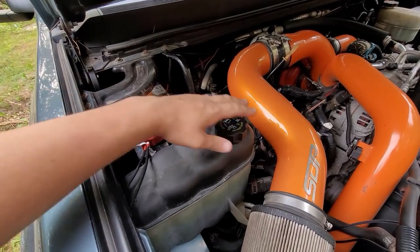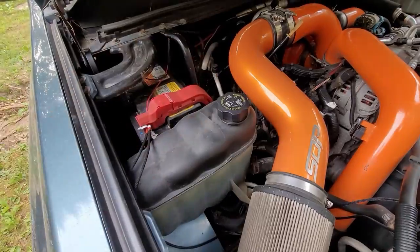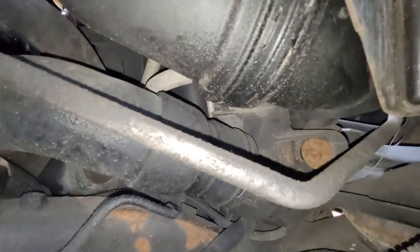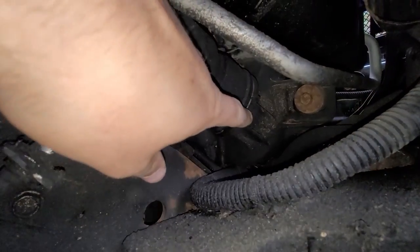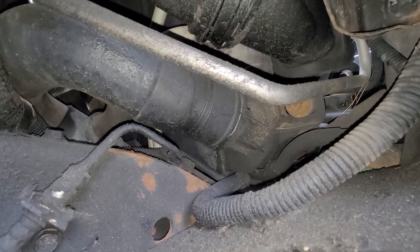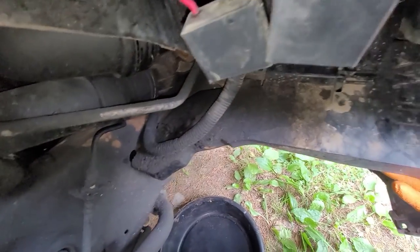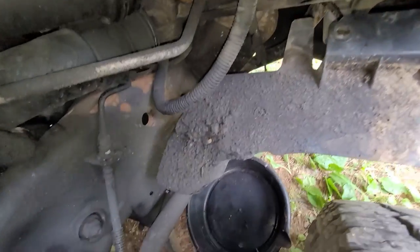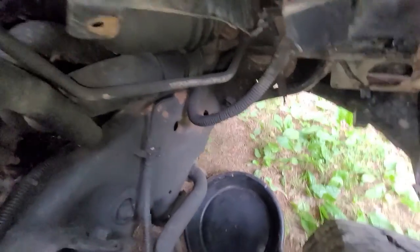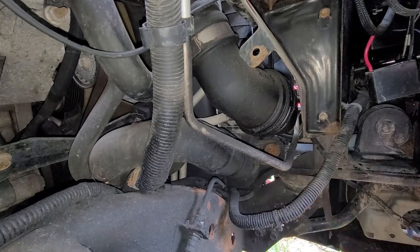Next, I'm going to take this cap off here to release the pressure, then pop that clip off right here and it should start draining all the coolant. Unfortunately GM did not include an actual drain plug. This piece has two clips and a hole on the left that holds the wire harness — just pops right out. These little pick tools are pretty nice. Don't lose this clip. While that's draining, I'm going to move on.